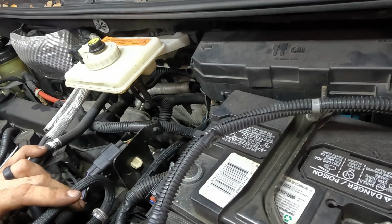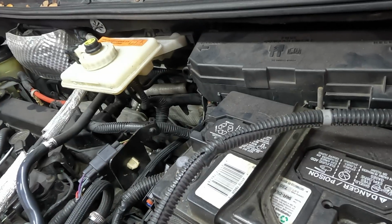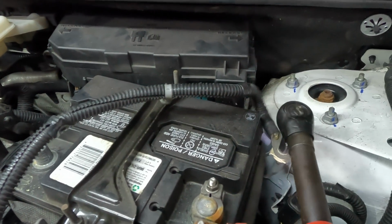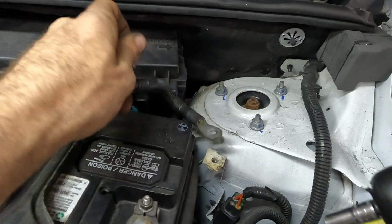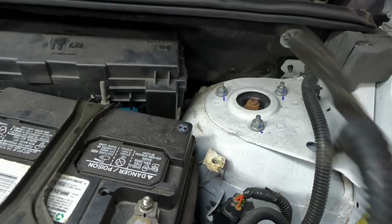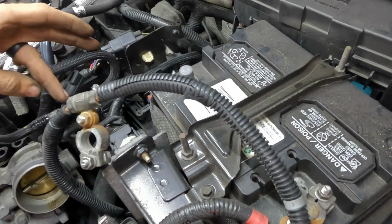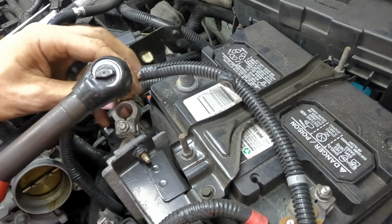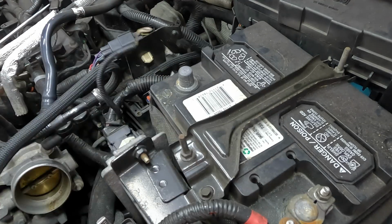Okay, so I can start to see some of those hoses down there a little farther. I think next, here, we'll pull this thing aside. Now, hang on. There. I don't need an air compressor to disconnect wires. That's the primary chassis ground. Let's just get that out of the way. I'm going to take this little ground wire off of here just so I can get this all the way out of the way. I can reattach that later. Let's get that guy set aside. There.